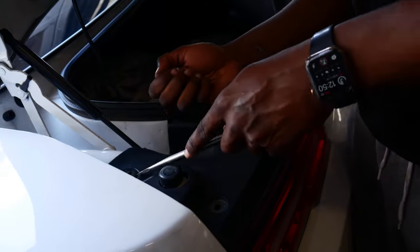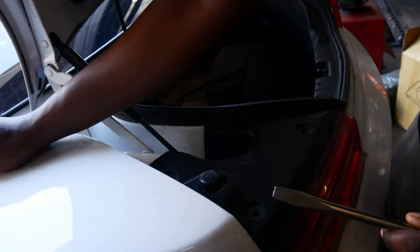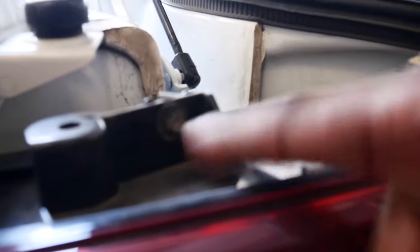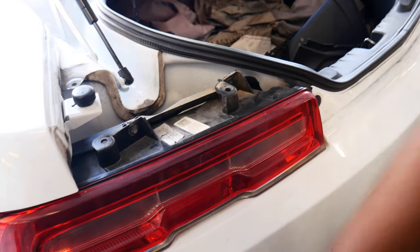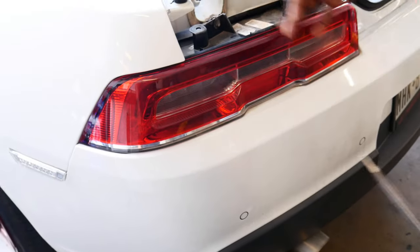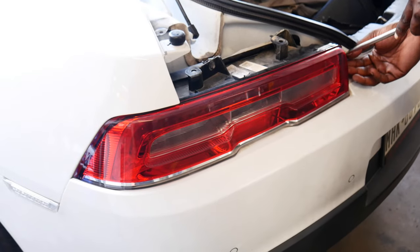One hour later. Set those aside, take the cover off and set that aside. You got two eight-millimeter bolts right here, you got this pin right here, and then there's some torx screws for the fender liner and a seven-millimeter bolt that goes right here. This whole thing will kind of drop down a little bit. Be careful — if you have the RS package like I do, you got the backup sensors, so be careful of the harness when the bumper drops.